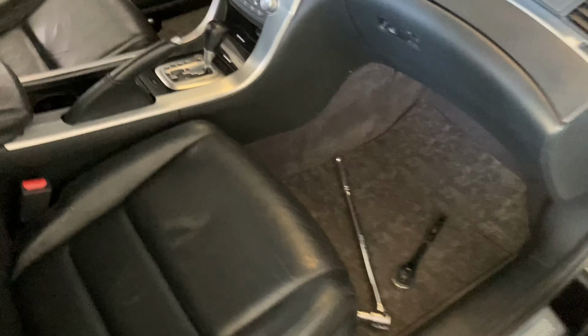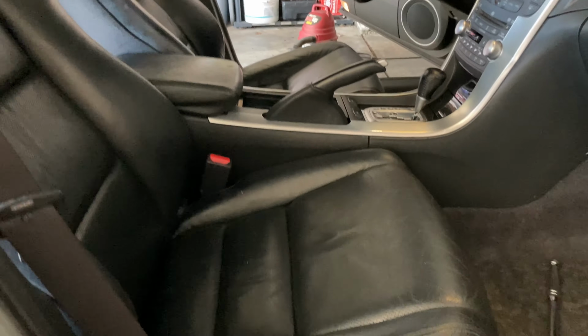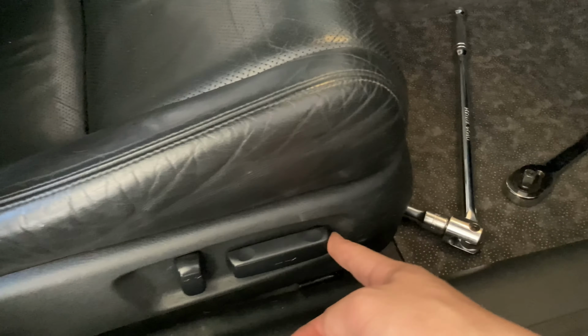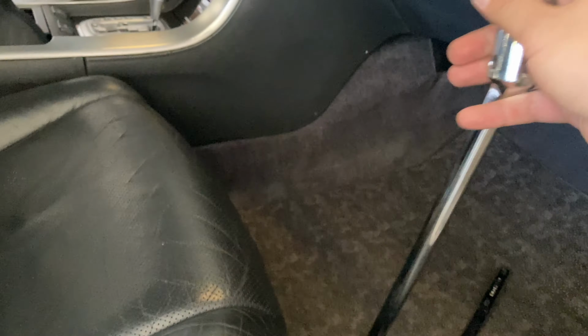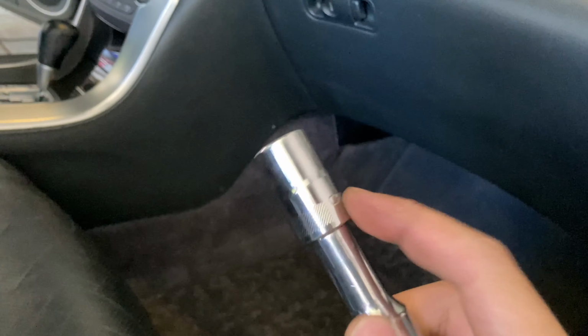So basically the whole entire thing is clean, but taking out these seats is something a lot of people have questions on. So what you first want to do is that there's four bolts mounted to the ground for the chair, two here and two in the back. Make sure you push this all the way back so you get clearance to these two bolts. And I recommend using a breaker bar with an extender or a long socket that's a 14 millimeter